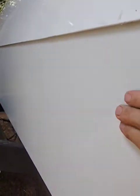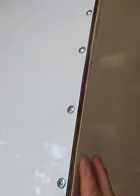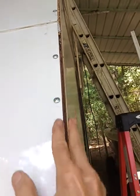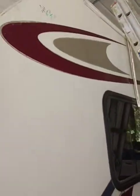So what I'm going to do is put this on here. I'm going to Rhino Line this, take my butyl tape and go over the top. Once I put screws in along here — like I've done up along here — I'm going to put butyl tape all along the edge here, covering over, making an L, all the way down here with my butyl tape. And then I'm going to put my J-rail on. I've secured my top rail up here.